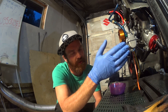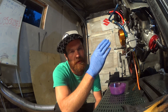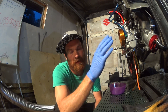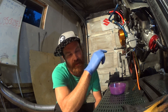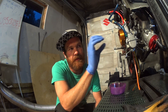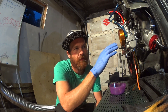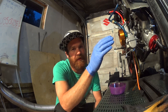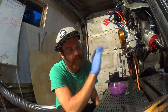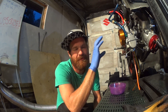This time when I tear it down, the valve was stuck shut — and that's why it wouldn't start. But I have a suspicion that it was stuck open, or maybe half open, when the bike was running, and it didn't really make a difference except that the bike made 17 horsepower versus 16.3 last time. So this has me thinking that maybe the pipe, and the crankcase volume, and the inlet length and diameter, could be about perfect for a wide open inlet — with no valve at all.